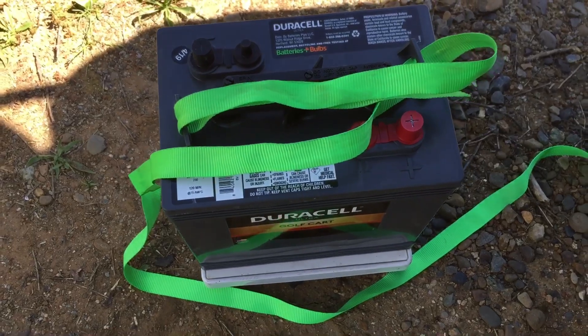I had three 12 volt batteries and I was running about 315 amp hours, so I'm losing some amp hour capacity. But I think these 6 volt batteries are going to be a little bit better as far as power delivery — but time will tell for that. I'll have them on this next trip that I'm taking down to Texas. We're doing a lot of boondocking on the way down and on the way back, so we'll put them through their paces and probably do a full review after I get back.